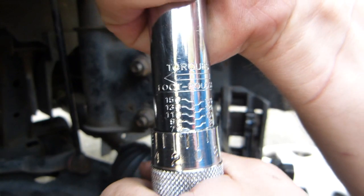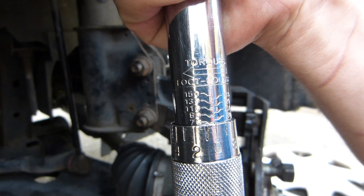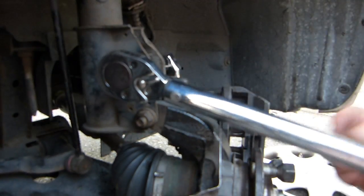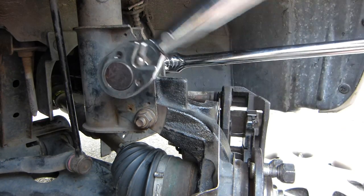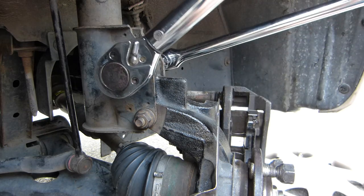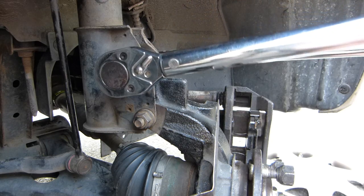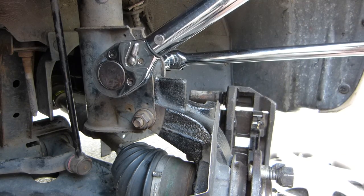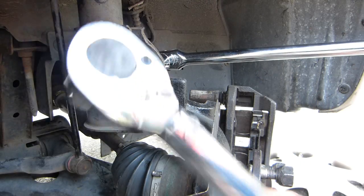70 is good — it has to be between 69 and 93, so I'm happy with 70. This is just snugging up the nut. Don't yank on it — pull it nicely and evenly when it starts tightening up. There we go. That's the click the torque wrench produces. It's been tightened to specifications.